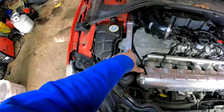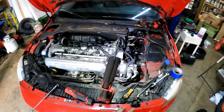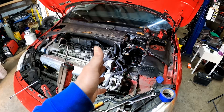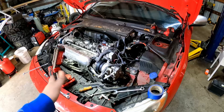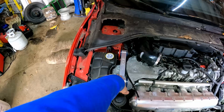I'm probably going to try to pull the torque mount — the IPD torque mount — off, and then the intake manifold, and maybe at the most get the rest of the pipe off and then the oil trap. That's going to be it for part one. I don't have the resources to show you guys everything as I'm doing it, so I'm just kind of showing you the steps. If you've never worked on a car before I don't know if I'd take on this job. Intake, intake piping, battery, plastics, intake manifold, oil trap, torque mount — and then I'm probably gonna call that a day.